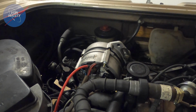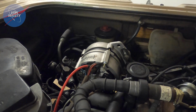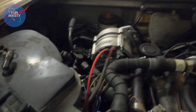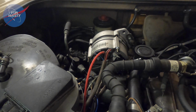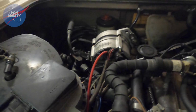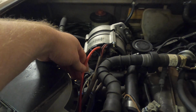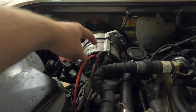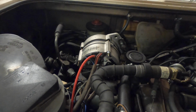When I got back home, I started checking a couple of things, and there were some suggestions that it could be an issue with the alternator wire, especially after what I had experienced here. So I went on Van Cafe. I had a couple of parts I needed to order anyway for some maintenance, and I picked up this cable. Basically, it's an 8-gauge wire. It's got the adhesive shrink wraps with lug type connectors on it. It's a real simple install.